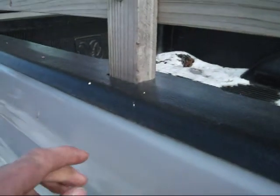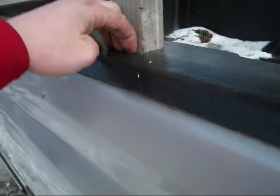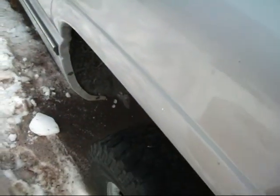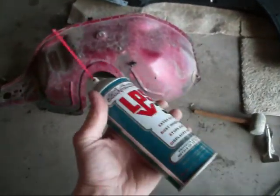What you can do to avoid that — on a Gen 2 Dodge, depending how the box is built, you can dump oil or diesel down the center stake pocket and it lays in that pinch weld where the metal is welded together, keeping it from rusting on the inside. Same thing with door bottoms — you can take your oil can and squirt oil up the little drain holes they put in the door bottoms. Or you can go to Fleet Farm or somewhere and get this rust inhibitor spray — it's about $12 a can.